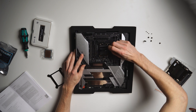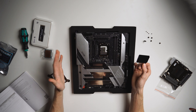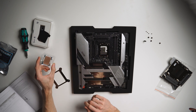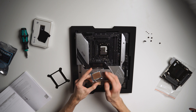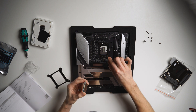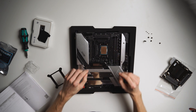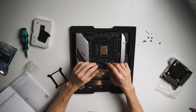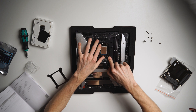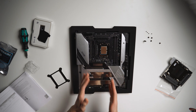You want to keep this label, because if you ever change a CPU or do anything with the board, or if you want to send it to an RMA, you have to replace this cover. Let's install our i9. As you might have noticed, I've already lapped this i9 — that's my liquid nitrogen i9, it's a really good one. The CPU installation goes as with any other CPU: just make sure you align everything, the CPU is placed in there with no play, then you can put it down and pull down the lever. Finished. Now we're going to apply some thermal paste and then put the monoblock back on it.